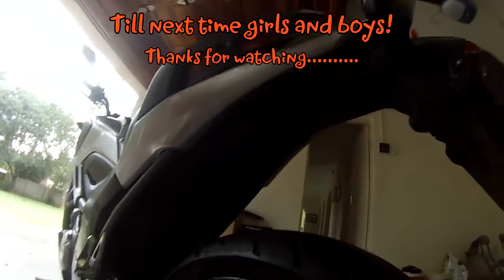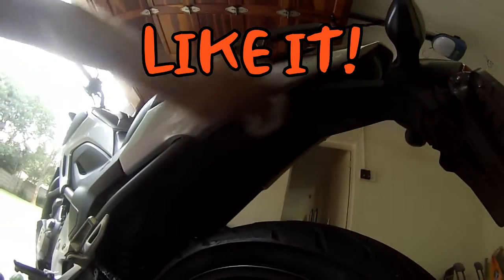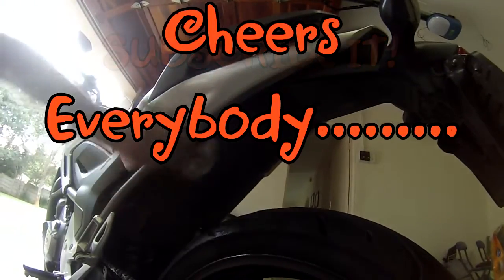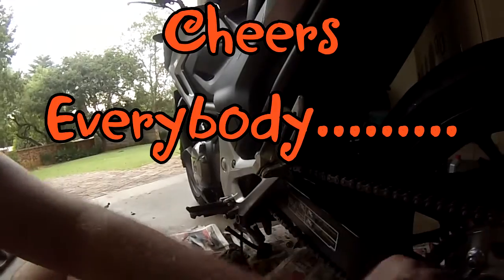It's always good to sit low and look underneath — you can see where all the mess is. This is all old lubricant from the chain splashing up underneath here. Always good to get on your butt and look underneath. As I said, paraffin — spray some on the cloth, best cleaner in the world. Give it a polish — look at that, all that grease has come off, now like new. Thanks for watching guys.